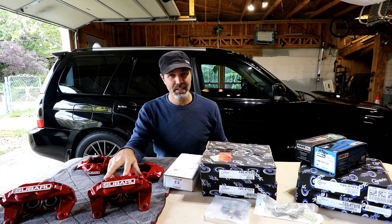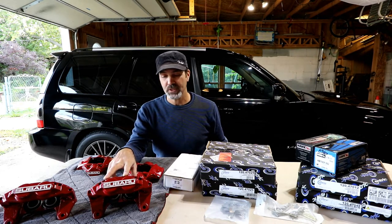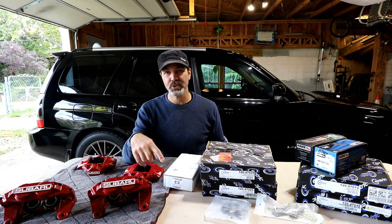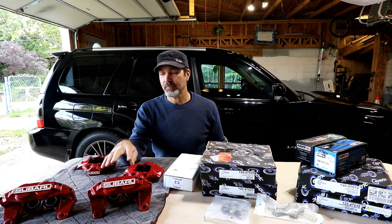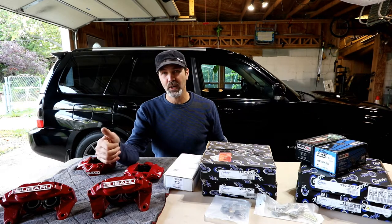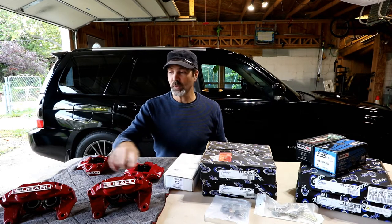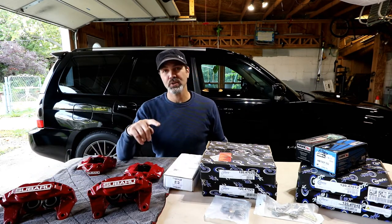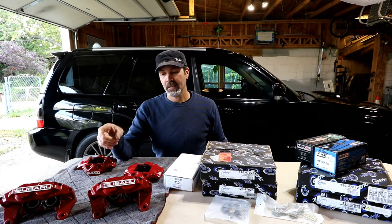which by the way did not look like this when I bought them. This is a complete rebuild. We're talking all new seals. I will put links down in the description for the parts that you'll need. But you buy one kit for the front, not two kits like some people have been saying, one kit, and it will rebuild both calipers. It gives you all new inner seals, outer dust boots, and snap rings, as well as whatever lubricant you need.